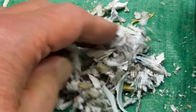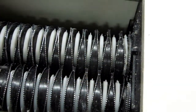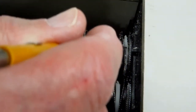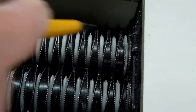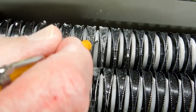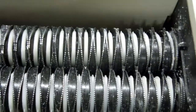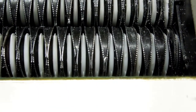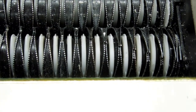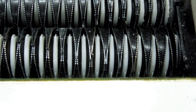This is the quantity of material that was removed from between that one set of cutters. And on the far end, these pieces of plastic were broken and came out. This white piece of plastic can now turn fairly freely on there, and it should not be able to. The plastic over here in the center is turning freely as well, so that's permanently damaged. Somewhere in here, this tooth is missing and this one is bent over to the outside. So I would say that's the death of a shredder.